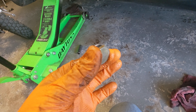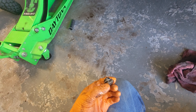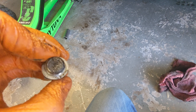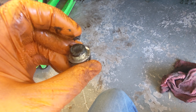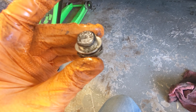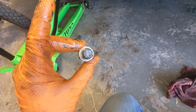Remember that top one, you can use a 9/16ths open end wrench, and the bottom one is a 24 mil. Make sure you take off the top bolt first — just like the differential, you don't want to drain it out if you can't fill it back up. I did take a look and you can see there's some trans synchro material on the drain bolt — not too uncommon in a higher mileage transmission. The fluid looked pretty good when it came out. This transmission does have a fifth gear grind at pretty much any speed, so this is probably mostly fifth gear synchro, but nothing too alarming. No big chunks of metal anywhere. Going to go ahead and throw this back in and fill it back up using some Motul 300.